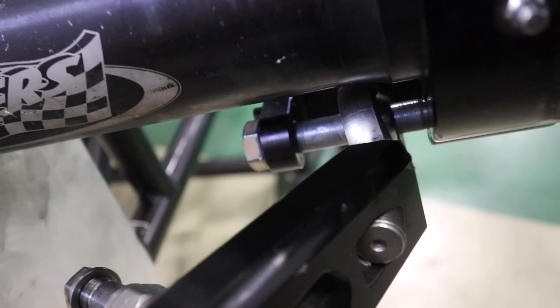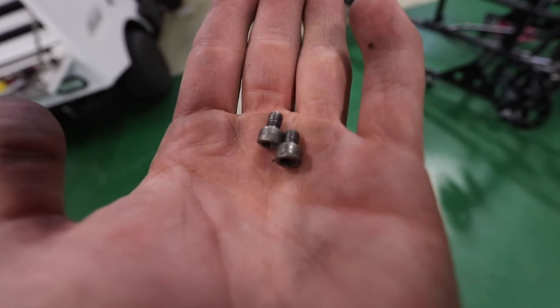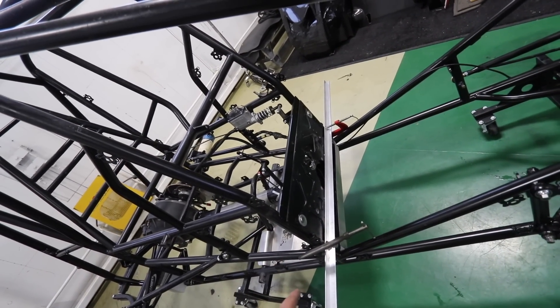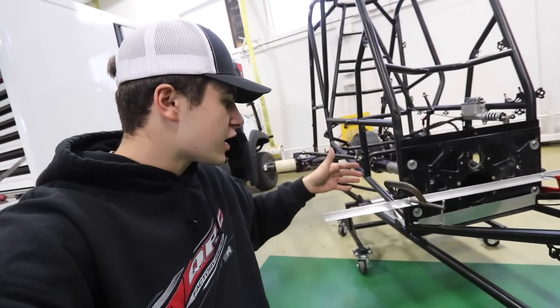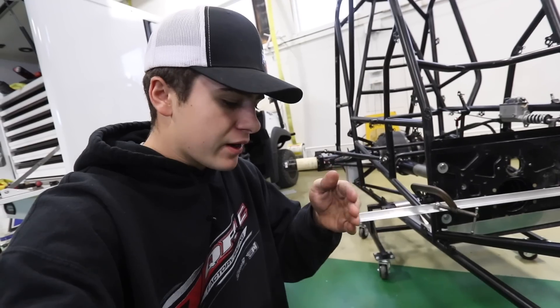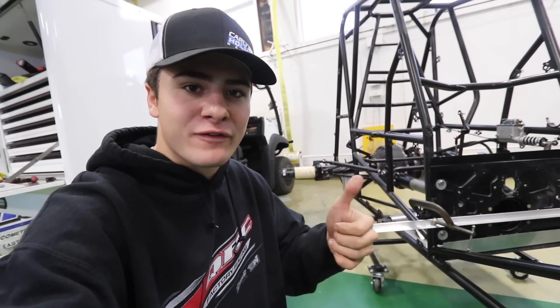The second key thing — and this is just my personal opinion — is the bolt that goes in the bird cage that holds the rear arm. There's a little allen that screws into the side, and its job is to eliminate the chance of that bolt backing out, because if it did you'd lose your rear arm and I can only imagine the domino effect from that. Third, and this is just how we like to do it at THR: we clamp some sort of straight edge to the side of the motor plate, and when you're measuring you're not questioning the exact mark — you have the straight edge, run the tape measure right over it, look directly down, and you can see if you're off and whether you need to go forward, back, or if you're right on the money.